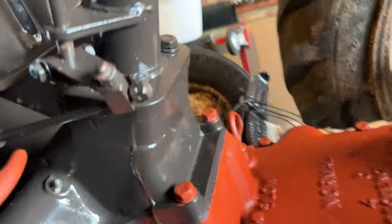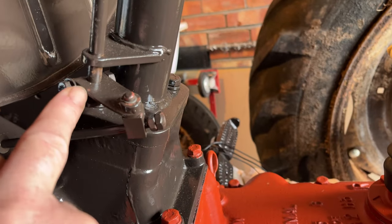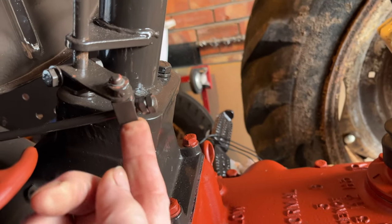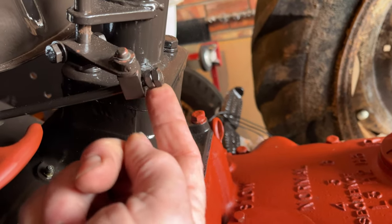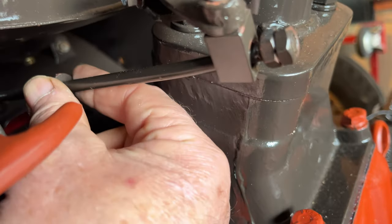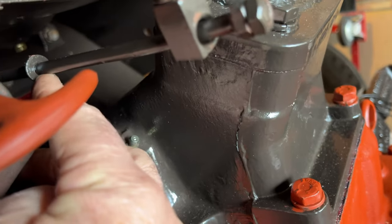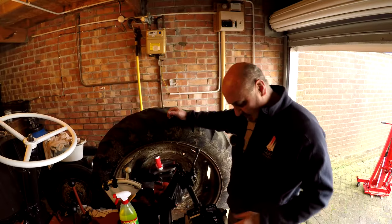Right, so we've got the throttle in here — see what I mean about this throttle. This is the bottom of the arm coming down from the dashboard. You've got your little offset here and this square block with a hole and a pin in it, and the throttle rod comes through the hole, double-nutted. I've got the replacement with a ball on the end but I need the little receiver cup to go on here. When I bought it, it had a spring on with a collar — to keep it tensioned outwards so that when you moved the throttle, the spring pushed on that collar and moved the throttle linkage forward. That's one of the little jobs I need to sort out.